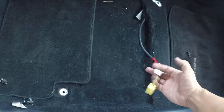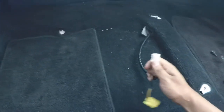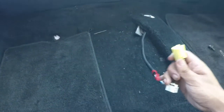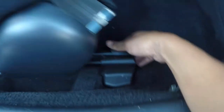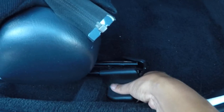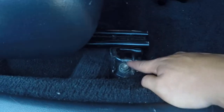After the bolts, you have one or two plugs depending on your car. This one is your sensor for the seat to tell you to put on your seatbelt. This plug is for your side airbags if your car comes with them — this one does. Some of yours are going to have a little cover for it. All you got to do is pull up a little bit and slide out, and that's all it is. Then you're able to see the bolt after that.